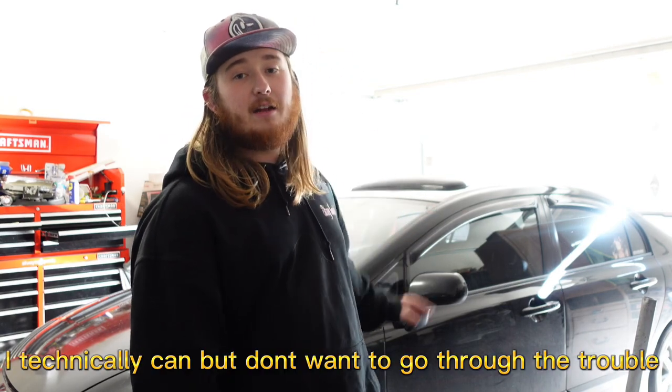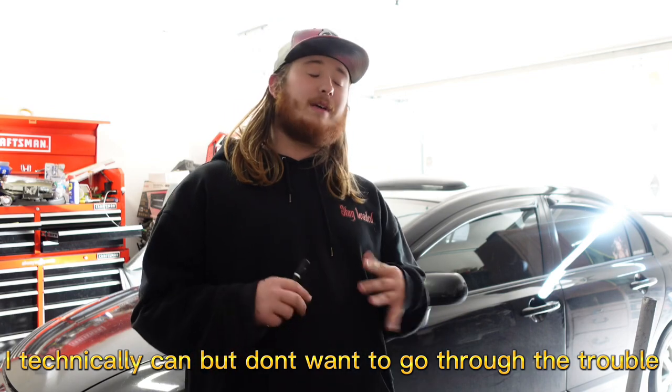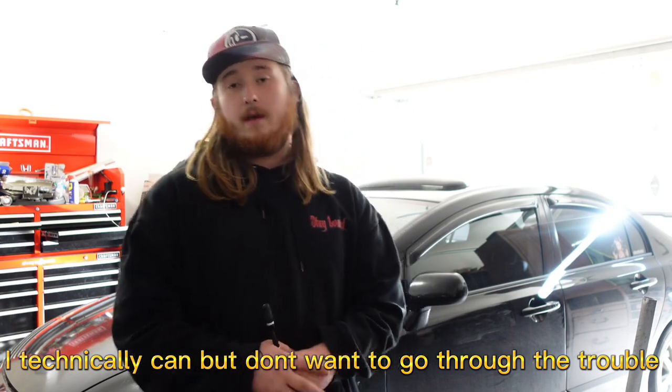So I can't afford to have a real cold air intake on this car. I really want it because the K-Series just likes as much air as possible — hence why we have the full three inch exhaust and alpha header. But I just cannot get a cold air. I even emailed my tuner and he said basically to go short ram or drop-in filter. But most short rams on these cars suck. Most of them are turned around and are aiming towards your header, so they're soaking in a lot of hot air, not cold air like you're supposed to.